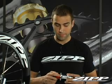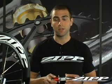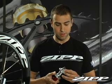We've also gone from using an oil to a lightweight grease in the drive mechanism, and what that does is just means it's less likely to wash out from rain and anything else, just less service you have to do to the hubs. We also added an adjustable preload.